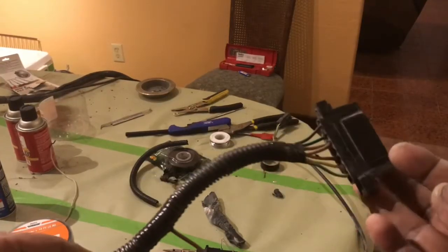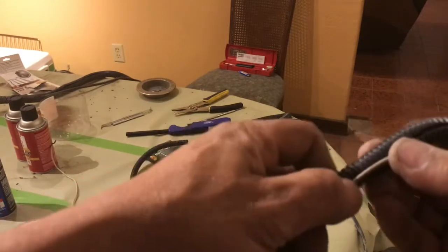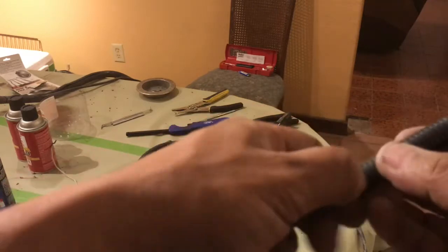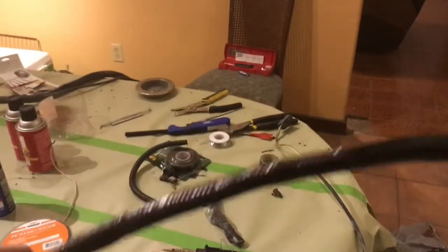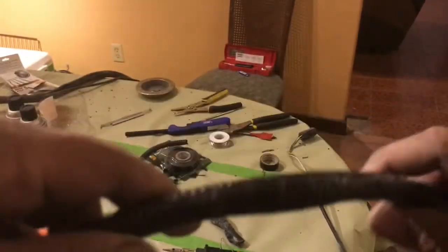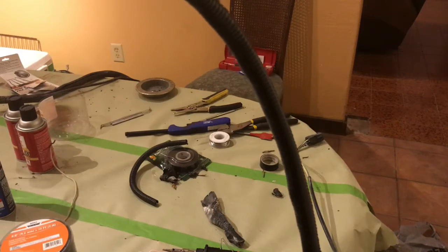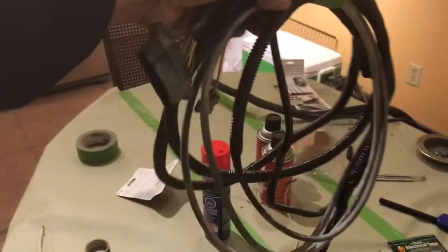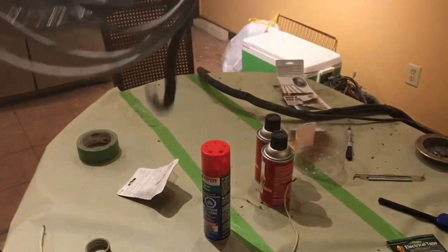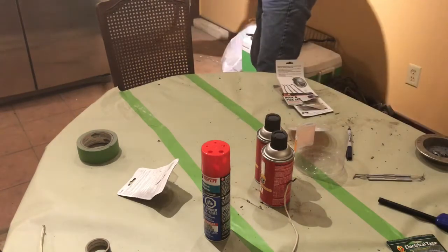This now looks a lot nicer than what it was. I took care of the solder joints, and one wire is out of the loom — I'll just tape it up a bit. All the part that goes under the trunk I wrapped in black tape to keep as much moisture and debris out of that loom, hopefully protecting those wires a little more. I got this rear light and fuel pump harness taken care of. There's the fuse box to tail light to fuel pump harness — got it all wound up and ready to go back into the truck.